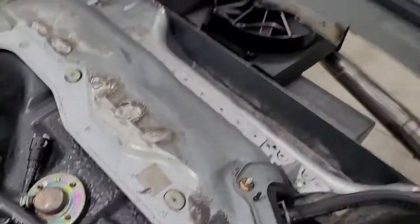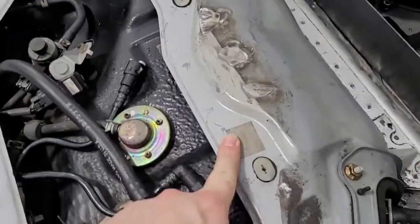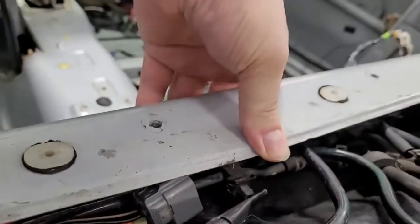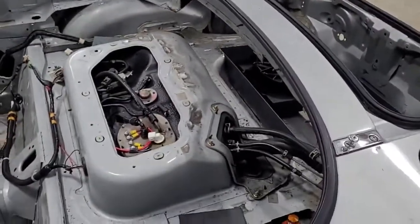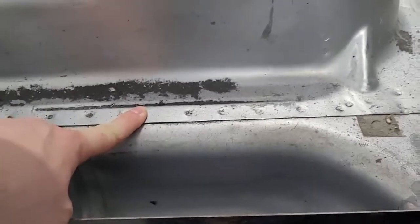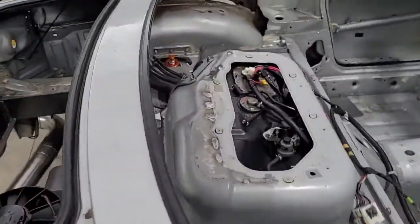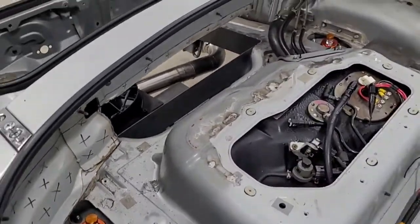This previously tied to the gas tank in the middle, which I don't think was great bracing. Like, I leaned on it and it bent — it's crazy flimsy. So as far as bracing, that's a terrible spot to brace. But there's a seam where two different pieces of metal come together here, and this looks rigid as hell. So we'll probably just do a brace straight down, and it'll actually be stronger as far as the bracing goes than it was before, because it had a piece of sheet metal angled that hooked to a gas tank shell — it wasn't doing much.